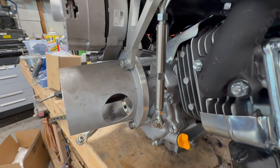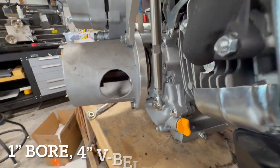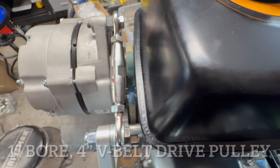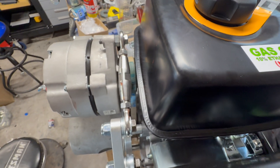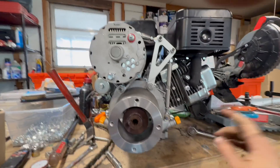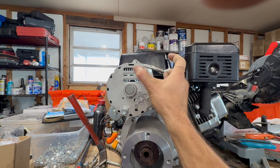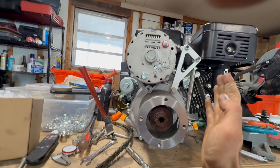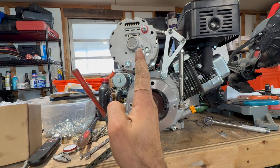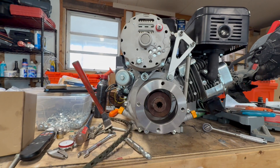So this is what the finished product looks like. We have our drive pulley in there and the belt running up, and it's going to be able to spin that alternator and power the AC on the machine. Belt tension is handled by an adjustment on this turnbuckle — it causes the alternator to tension the belt fully, and if you kept going it would fall to the other side.